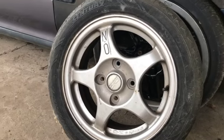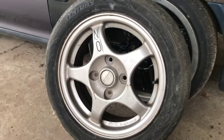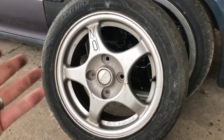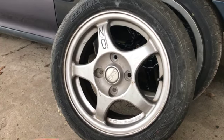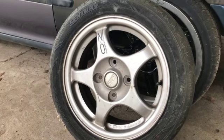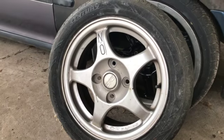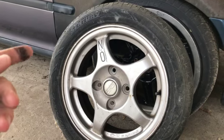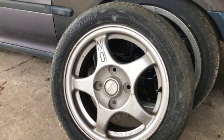These are OZ Racing wheels made by Enkei. They come on what I think is called the Rally Art Lancer. They have a super high positive offset and they're four-by-114, but of course all Civics are four-by-100, so I have to run an adapter — which is no big deal because I'd need a spacer anyway to get these wheels to fit. I had them on my EK at one point. Let's go ahead and get the wheels swapped out.